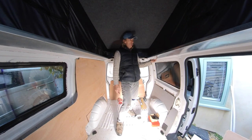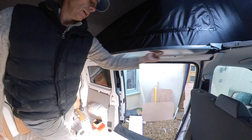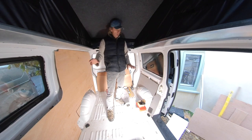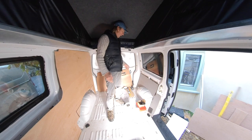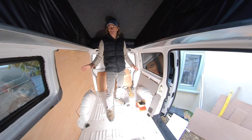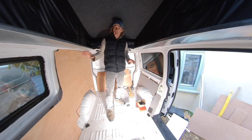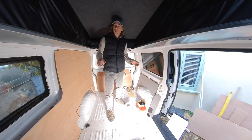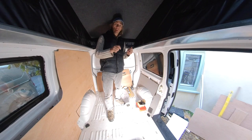On this one, I'm going to run a strip light all the way along this rail and come up with a design for that later. The rest of it I'm just going to surface mount, because you don't need to put cables inside walls on these vans — there's so much furniture and stuff that you can hide it behind. The way I like to do it is panel it all out, carpet it all out, and then surface mount any electrics. That means if you ever want to change anything, it's all easy to get to, to repair it or replace it.